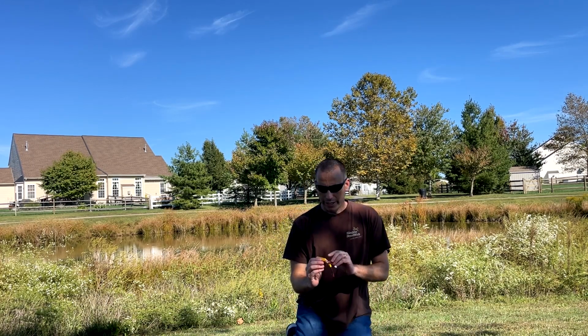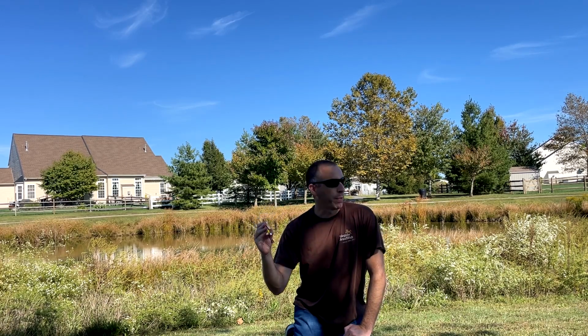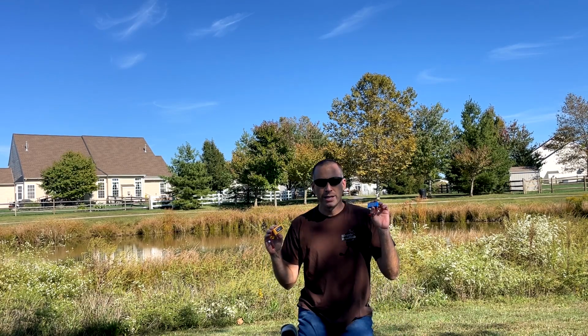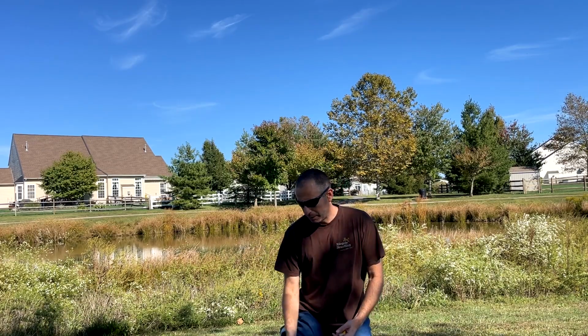I recently got this Liperior battery sold by rcbattery.com. It certainly doesn't break the bank at $7.50. It's an 850 milliamp hour 2S LIPO. So instead of Li-ion, I'm gonna run LIPO in it, and we're gonna see how much longer the runtime is, if any, see if we see any increased performance, perhaps an increase in top speed.